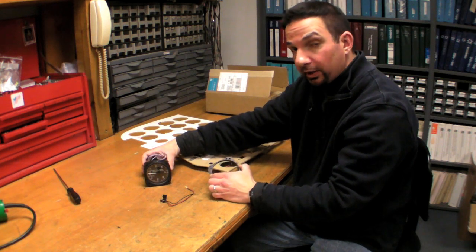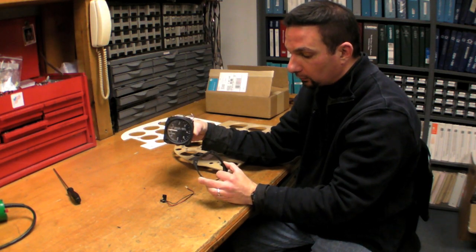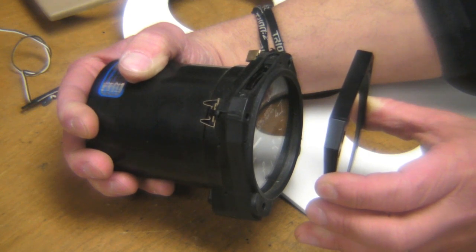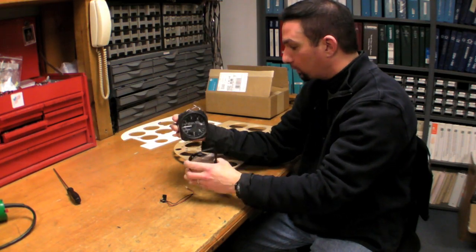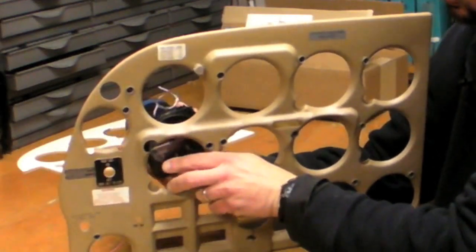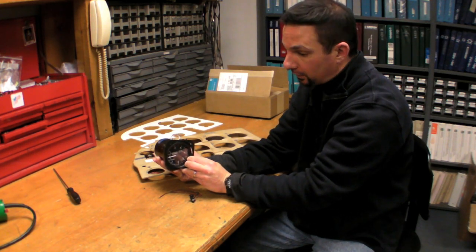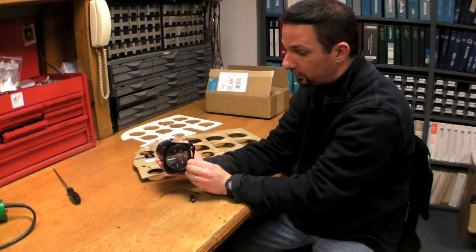A more modern and better way of lighting an instrument is using an instrument lighting wedge. There are several manufacturers that make these wedges — one of the more popular is called a NuLight. It is simply a lighting wedge, or bezel wedge, that has incandescent lamps built into the bezel itself. They get wired in series to as many as six, seven, or eight instruments that you need lighted, and simply fit over the bezel of the instrument. If you're using an overlay and want to retain your plastic overlay, the wedge will fit between the instrument and the overlay. If you're using a flat metal panel, the wedge is placed between the panel and the instrument itself. That's a preferred way of lighting an instrument because you get uniform lighting around the entire bezel, which prevents the parallax and blinding effect seen with internally lighted instruments.